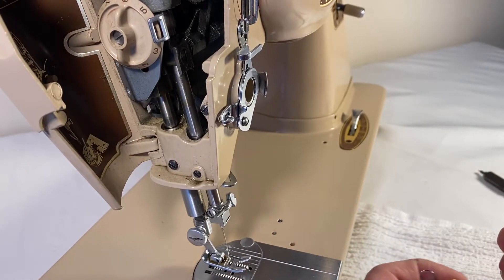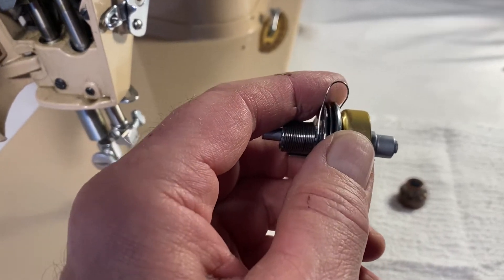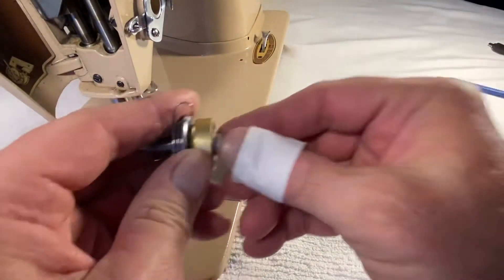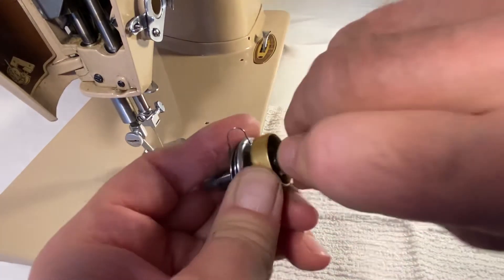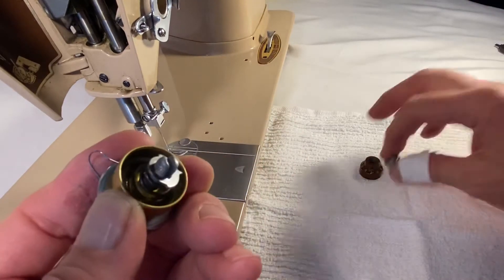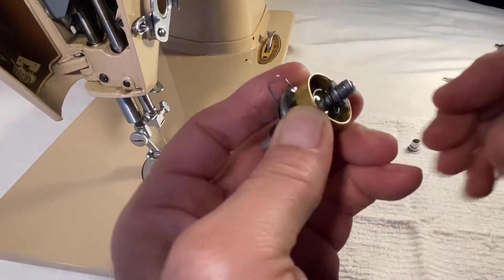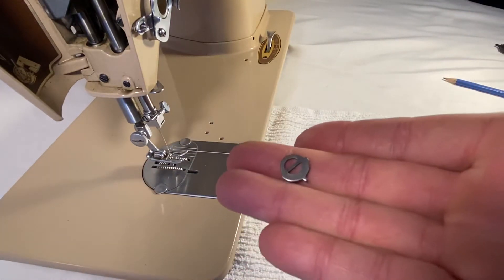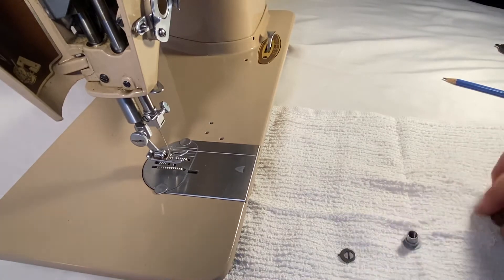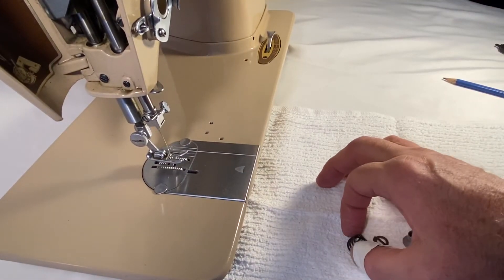I loosen it — that's loosened enough. I'm going to move the camera down here a little. So this is the adapter; you could even call it a needle thread tension adapter to be official and technical. By the way, this is called the dial or number dial. There is the tension adapter, and it butts up against the stop washer.